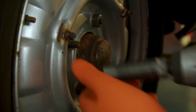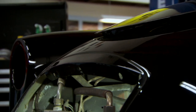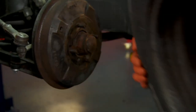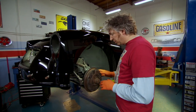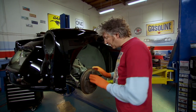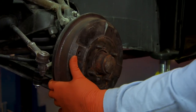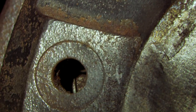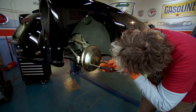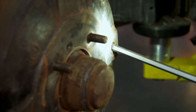I've also got plans for the wheels, which will add yet more glamour. Before I press on, there is some fault-finding to do. Mike complained about juddery brakes when he gave the car over to me. That can be caused by a number of reasons, but normally it has something to do with the front brakes, and thankfully there is a simple way of checking. This car has brake drums, which are nice and easy to inspect. Line up the hole in the drum over each brake adjuster, unscrew, and the drum will come away. I suspect the judder is caused by distortion or warping.